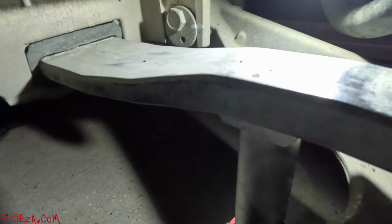All right, guys, another thing I want to talk to you about is where to actually set your jack stands. As you can see, I have it on the leaf spring itself. That's to relieve the tension that goes on the actual lower control arm. So bring it up with the jack. There's a cross member right below, right there, and sit it there, bring it up, and then you put a set of jack stands, one on this side, one on the other side, as close as you can to the leaf spring, closer to the lower control arm, and then drop the jack, and it'll sit on the jack stands on the leaf spring itself. That'll relieve all the tension, and you'll be able to do what you've got to do.